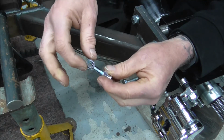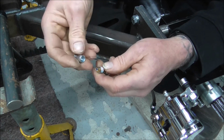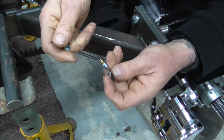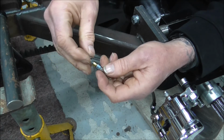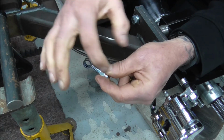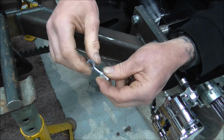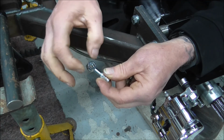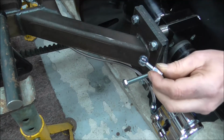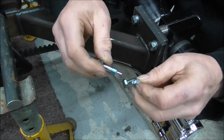So if you imagine, the idea is that you clamp the pipe tight, equally tight all the way around, that's why it's tapered, but you're clamping the pipe onto that as tight as you possibly can, obviously because you don't want it to leak. So by me turning the fitting itself, if that pipe's not moving, that means that fitting's turning inside the pipe. If that fitting can turn inside the pipe, the way I see it is that it can't seal. Now I might be 100% wrong on that. I'm not the world expert on putting brake lines together, but that's just how I see it.